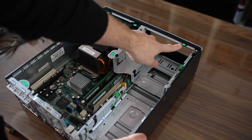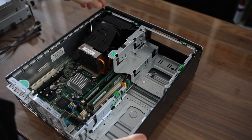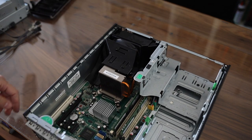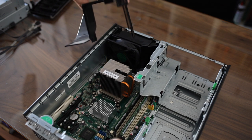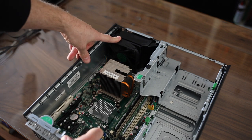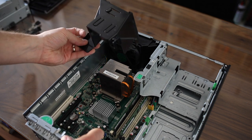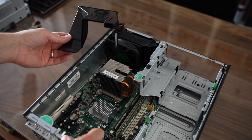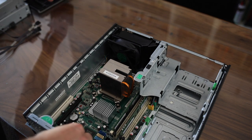You're going to see three green plastic latches here that you can just pull up on, and that will get the front cover loose. At this point you can grab this entire plastic assembly and just pull it right up. Here you have the CPU fan and the plastic that's attached to it. You can or cannot use this whole assembly — the fan and plastic piece is pretty big so it might not fit your bar top. If it does, you can use it; if not, that's what the other heatsink and fan I showed you at the beginning is for.